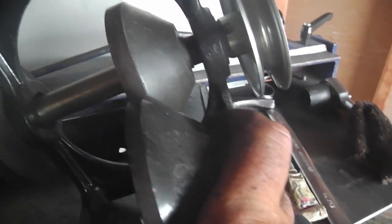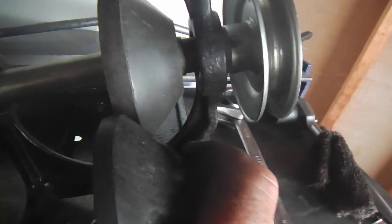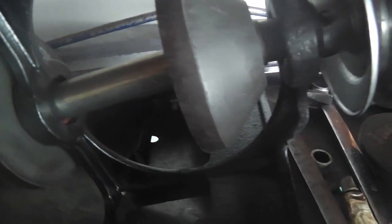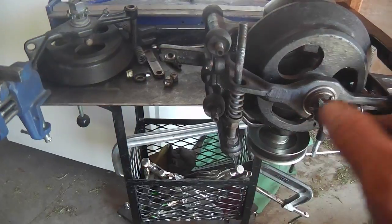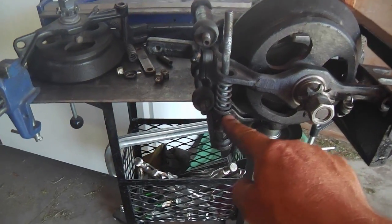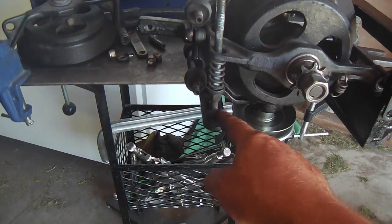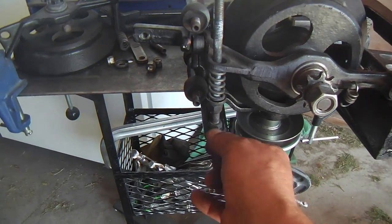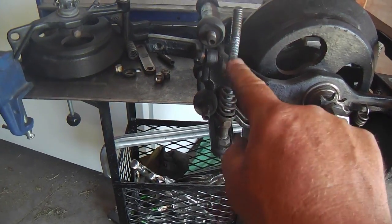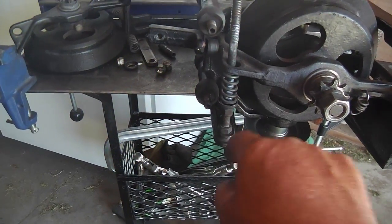And again, these newer cones have more skirting, probably a quarter inch more. So maybe this will be a little more stout when it comes to having that problem that I had. It might not happen with these. One side of the disc cup going on, it's pretty straightforward. The threaded rod, you can grab a hold of this lock nut, and it'll thread it without losing its place. And then you can get the jam nut tight. Once it's seated down underneath here flush, and you got the jam nut tight, then you can start to adjust these, and the rest of the rod won't move.